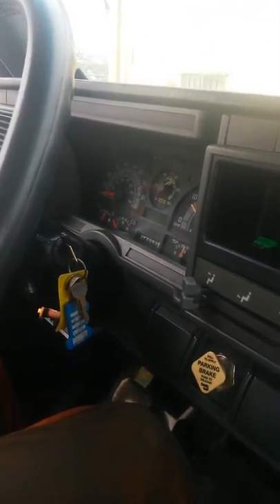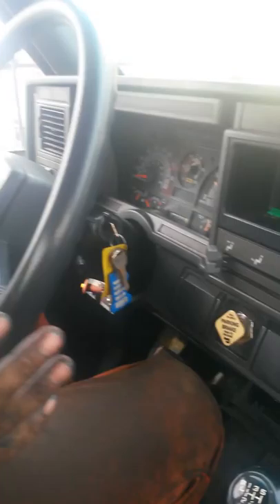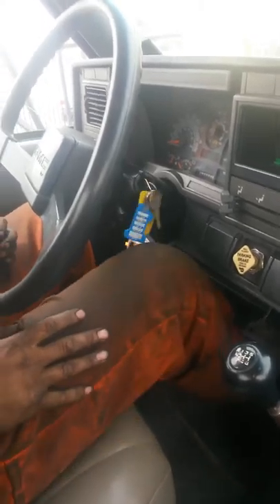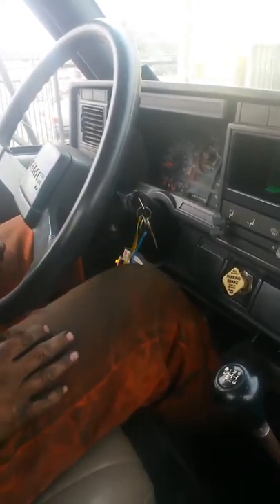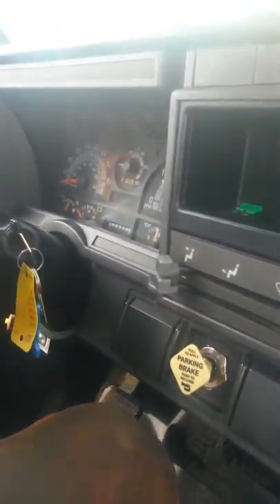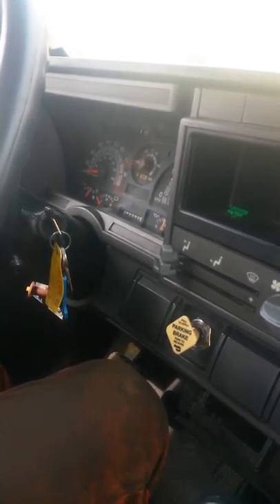One minute has gone by and my needles did not drop more than three psi — in fact they dropped zero psi, so that's a good test. For my next test we're gonna make sure that my spring brakes come on automatically. For this test we're gonna deplete air pressure until the parking brake pops out — it needs to pop out between 20 and 45 psi. We can see that the parking brake popped out at approximately 27 psi, which is good because it's within our manufacturer specifications.